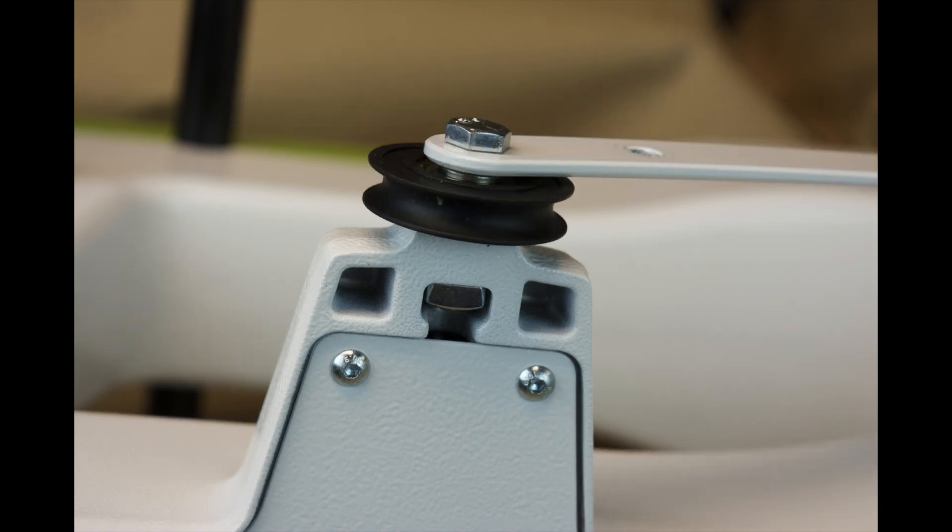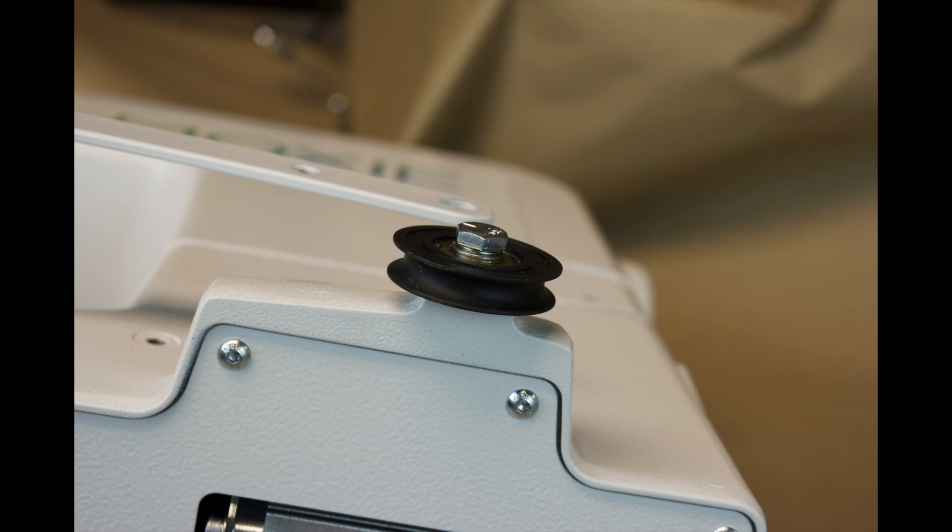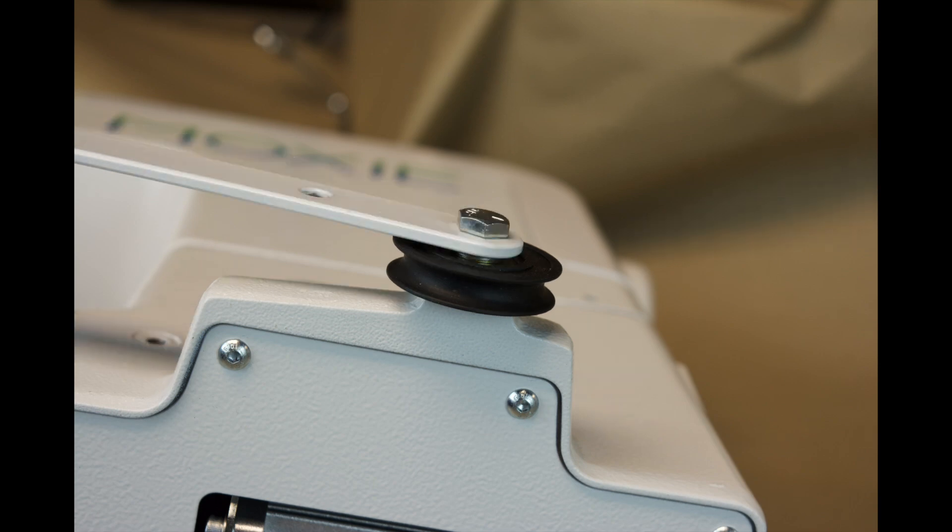Now place the bolt through the Y-axis drive motor bracket, then slide on one of the small washers, then slide on the wheel, then the other small washer, then tighten into the square nut as shown. Tighten just until snug — we still have to attach the back end of the bracket. Now remove the bolt holding on the rear wheel. This part is not as tricky because there is no square nut to worry about, but there still are washers that need to go back on either side of the wheel. Move the bracket into place as shown. The bolt goes through the bracket, then through the outer washer, then through the wheel, then through the inner washer, then threads into the sewing machine. Now you can tighten these bolts securely. After tightening, make sure the wheels spin freely — if they don't, then more than likely one of the small washers is missing.